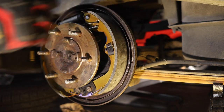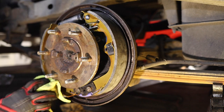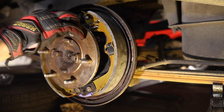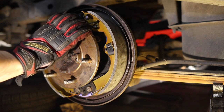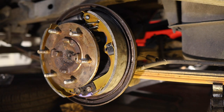It is in there — we're pretty much good. Be careful with any dust from the brake components as it could be potentially hazardous, so make sure you're not breathing any of the powder. The big spring is where it needs to go. This is basically done as far as the pads and springs — everything is in the right place. Now we're ready to put the actual drum on. Don't forget to clean the inside of it with brake cleaner first — it comes coated with oil to prevent rust, so clean it very well before slapping it on.